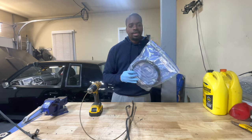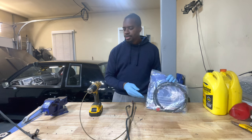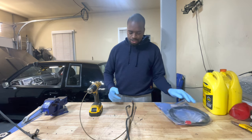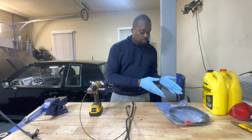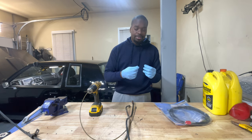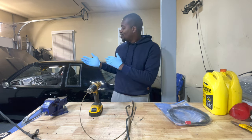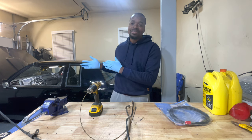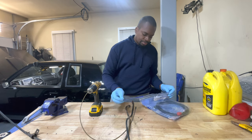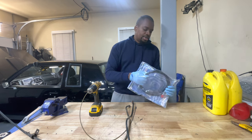I found part number CA3003 — it is a 100-inch cable for the Buick. I also found an ignition control module that'll go on the T-top. I just wanted to take a look at this new one, match it up to the old one, make sure the ends look good and the wire that comes out looks about the same before trusting 35-year-old parts. I had to go to a local Hub Auto Parts store to get it — about half an hour each way, but well worth it.